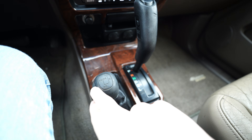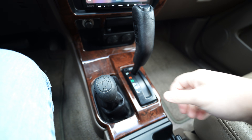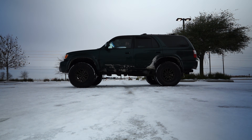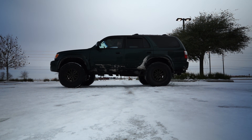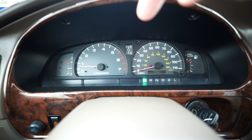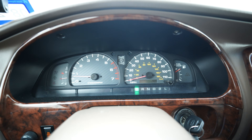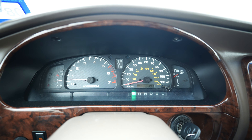But if there's any snow, rain, or ice, all-wheel drive is where it's at. However, if you're off-roading, all-wheel drive isn't going to really help you. For normal everyday driving, your button is not pressed and your shifter is going to be in high 2 — that's basically rear-wheel drive with an unlocked rear differential. And if you have four-wheel drive, that little indicator light is not going to be lit or flashing, and the center button's not going to be lit either.